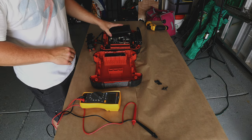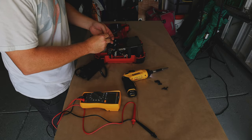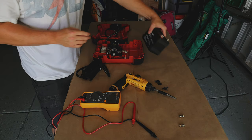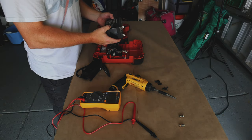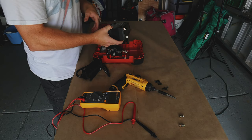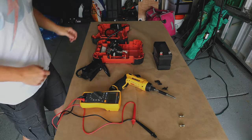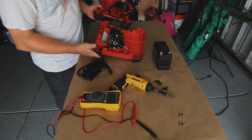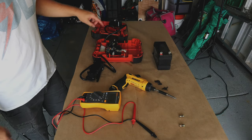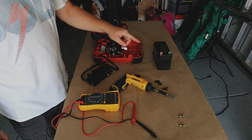We know all that circuitry is working because we see the charging voltage across the battery. We're going to take this battery out so I can put it on a tender. We can see the terminals and lift it up. It's a Chinese battery — 12 volt, 9 amp-hour, non-spillable sealed lead acid, 'do not short circuit, caution, made in China' — Xing Ying, 9 amp-hours. I don't know what cold cranking amperage you'd get out of this, but my guess is it's severely overrated. The rest is just simple circuitry — a switch, overcharge protection, and circuit boards for the USB ports, lights, and rectifier circuits to bring AC down to DC charging voltage.